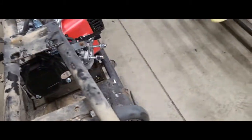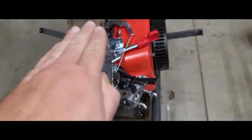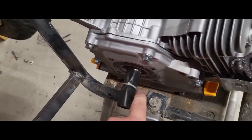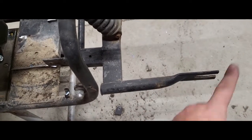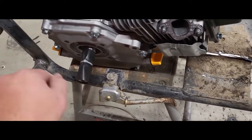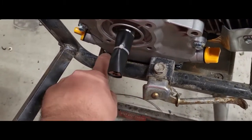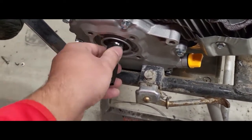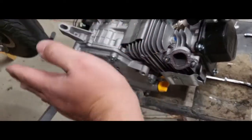My other issue is figuring out the tilt. I'm gonna have to mount the plate up a little bit because if I put the engine completely centered into the frame of the bike, the drive shaft will be sticking way out and the clutch will be over here outside the realm of the sprocket for the tire chain. So I need to move it in more. If I push it flush and mount it underneath, the clutch would still be sticking out way too far - I'd have to move the engine back that way more.